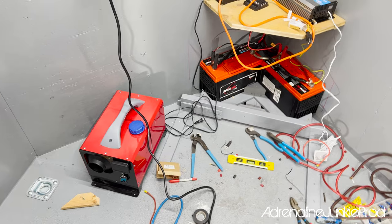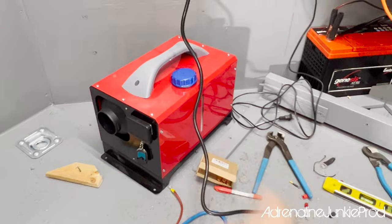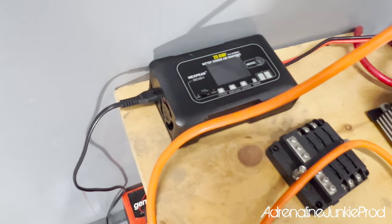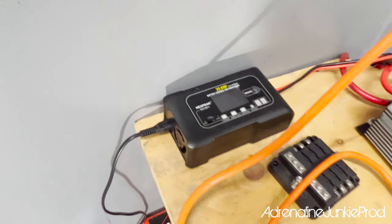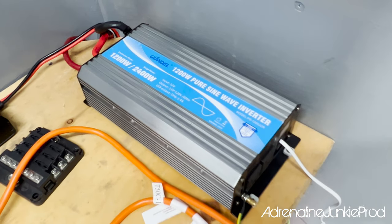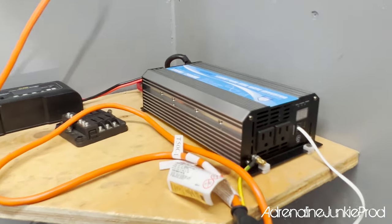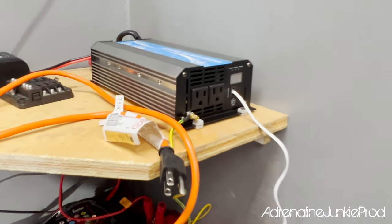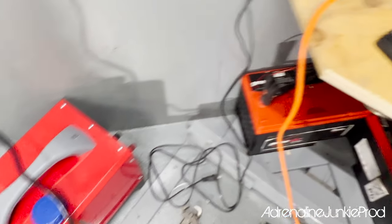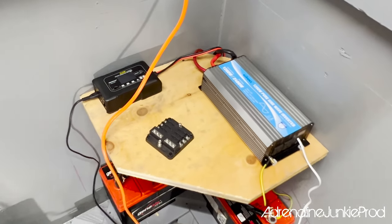Got the heater kind of in place. I'm not working on that yet — the price is that it's super lightweight and it comes with all the plumbing and stuff; I'll show you all that later. The batteries are mostly wired up. The charger is in place — only about 40-ish dollars on Amazon with good reviews. Got this power inverter on Amazon as well, 1200 watt. It says 2400 peak, but reviews say it's more like 1300 peak. I've also got a six-way 12-volt distribution block — the heater is going to run off one of those, and in the future I can easily tie in more 12-volt accessories.